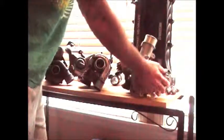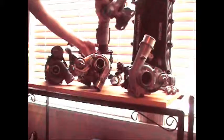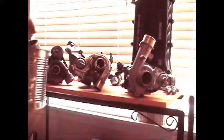That's your fundamentals here. It bolts up, exhaust goes in, spins the insides, builds up pressure, pushes it out here, and then dumps the excess out of the downpipe. That's basically all there is to it. I mean, here's the downpipe for this turbo. See, it just bolts straight, just goes right to your exhaust. So, that's pretty much the basic fundamentals of a turbocharger.